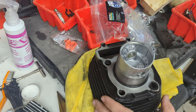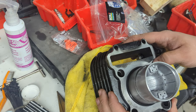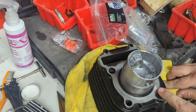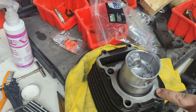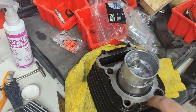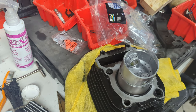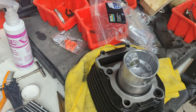We're nearly ready to pop this whole ensemble on the bike. The dowels are already on the bike, and the only other thing to worry about is that one of these — the oil channel that lets oil come up to the top of the engine — needs an O-ring in the block for it to seat against. You can see the rest are chamfered but this one isn't. It also frustratingly has paint on it; I don't want to take anything too abrasive to it as that's just asking to wreck things. I'm going to take a second, have a look at all of this, and make sure I'm not doing anything catastrophically stupid before we put this together.